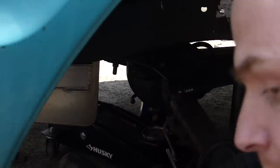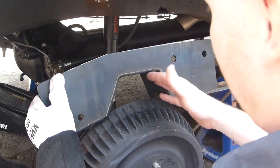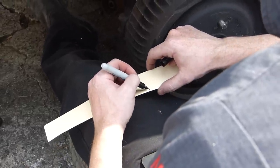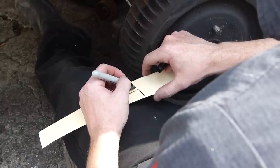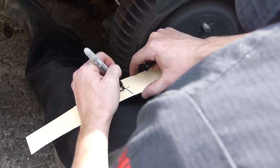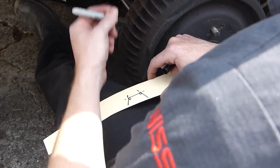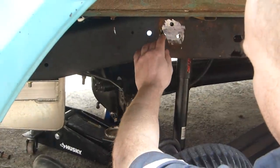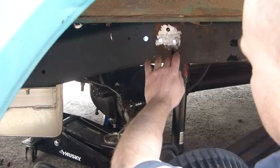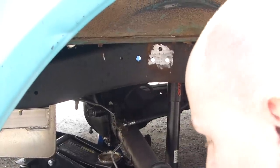So if you look at the notch, you'd basically have an angle and an angle. If I cut with the angle grinder, I'm probably going to end up out here and out here to cut it. Well, if I drill this corner, an arch is stronger than anything else. So if I cut here and here, I won't be way out here, and this arch actually makes the rail stronger because I don't have two pieces cut that are cut past each other. Yep, makes perfect sense.